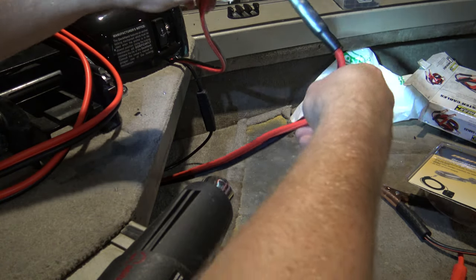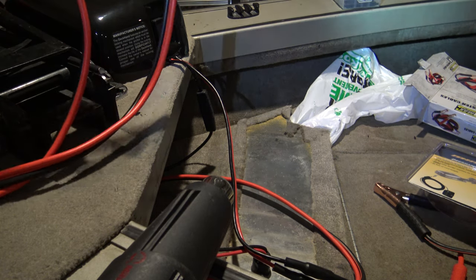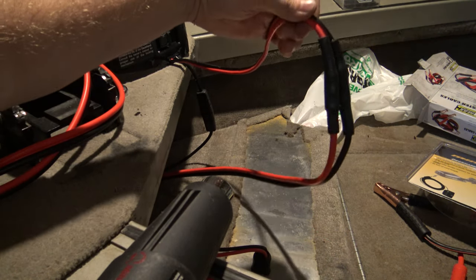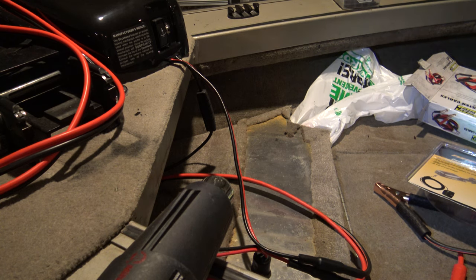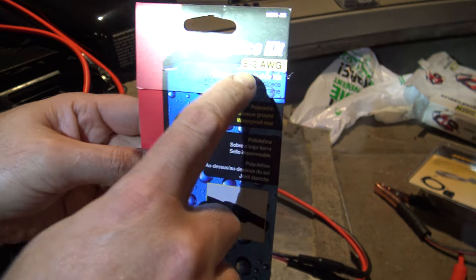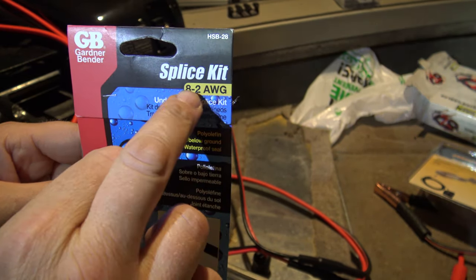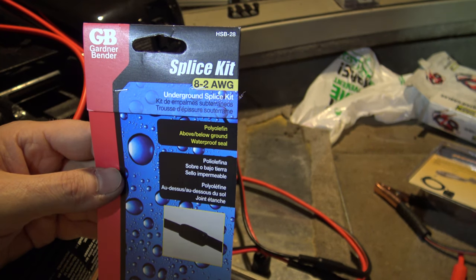So that's my two connections. Like I said, this is for my electric anchor, and now I've got about 12 feet of this nice supple battery cable to run back to my battery. I'm never going to have to worry about the splice connection. I hope you found this video informational and helpful. I'll put a link in the description for that splice kit. Just make sure the splice kit comes in the right gauge range — it'll say something like 8 to 2. Make sure whatever booster cables you get falls in that range. You want either 6 or 8 gauge. That's what seems to work best. Thank you guys for watching.